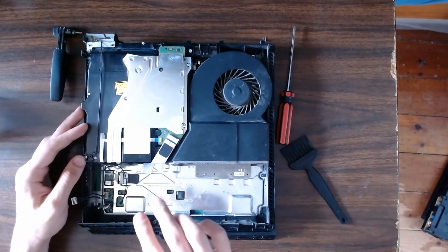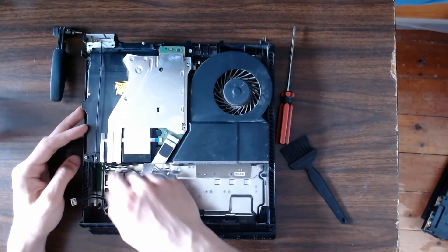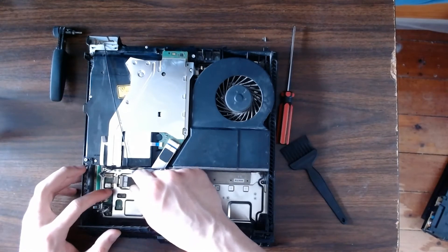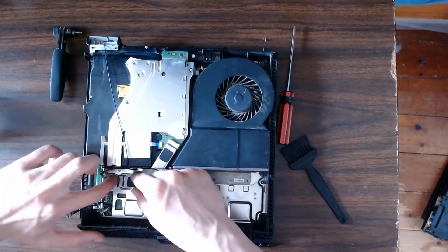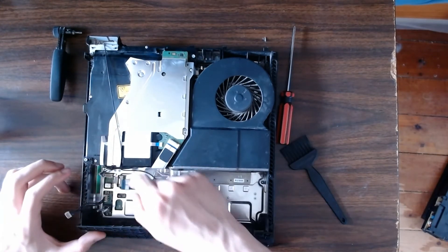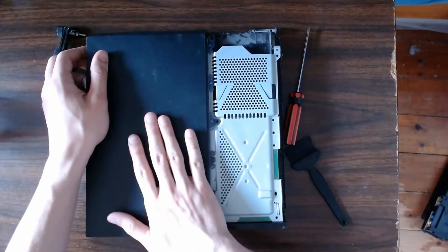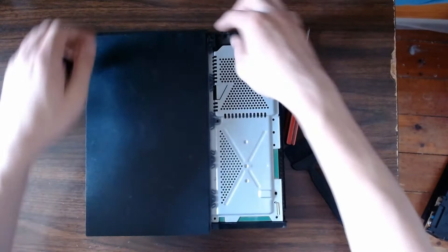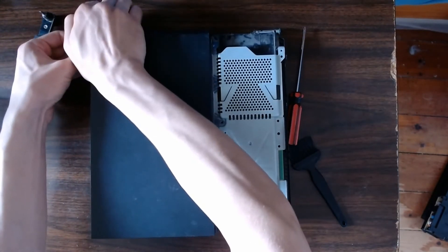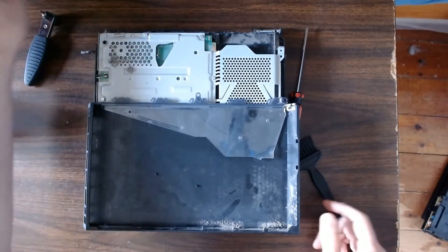What you do have to do in this step is disconnect three things: the Wi-Fi antenna right here — just give that a tug and it'll come right off; the optical drive power connector — tug that out as well; and finally the data ribbon cable for the optical drive. To disconnect it, press down gently on the small silver rectangle while you pull out the band, and it'll come right out. Now flip over the console. You're going to want to pop off this top part — pull around this edge and it should just pop, then give the other edge a good tug. First thing, clean out all the dust in here, then put the cover aside.